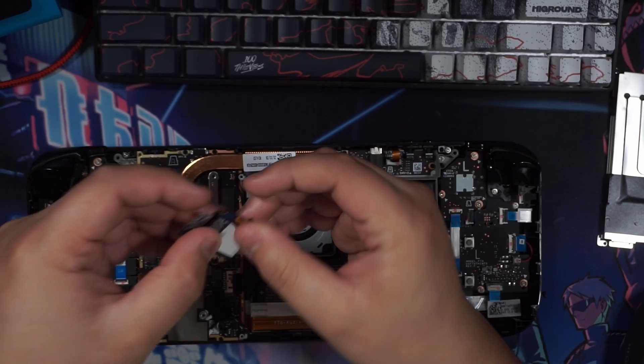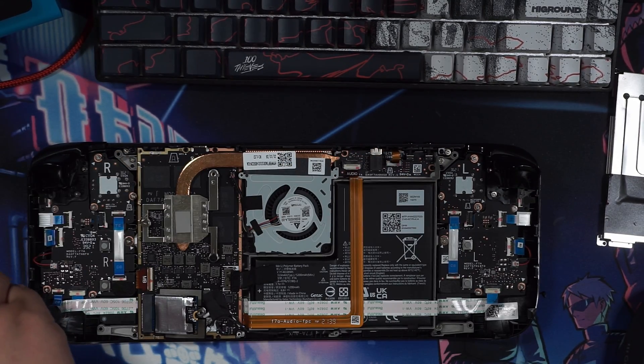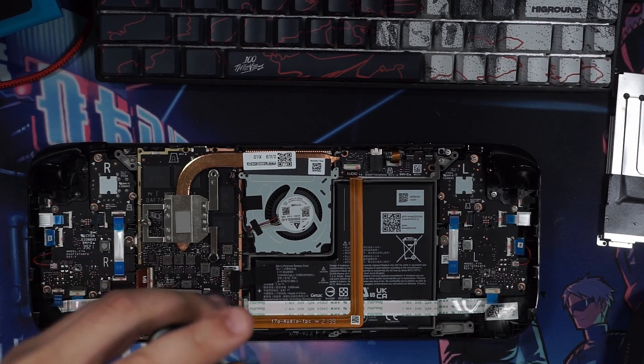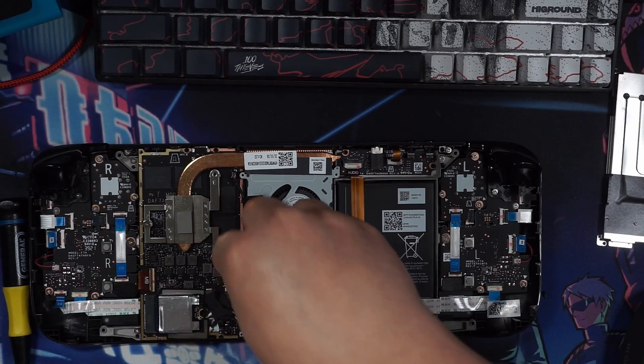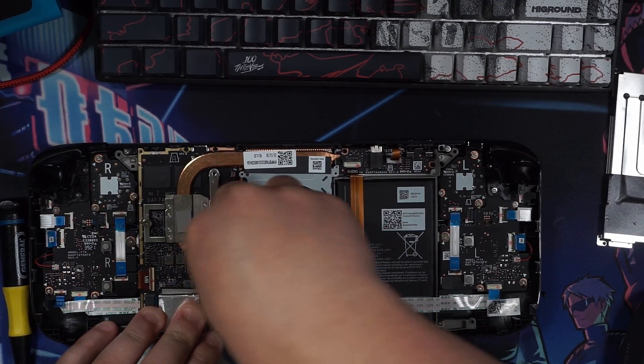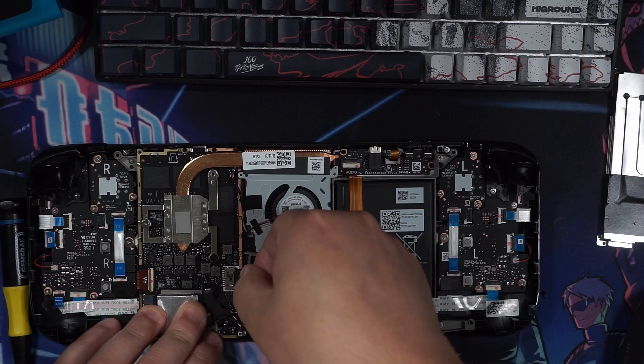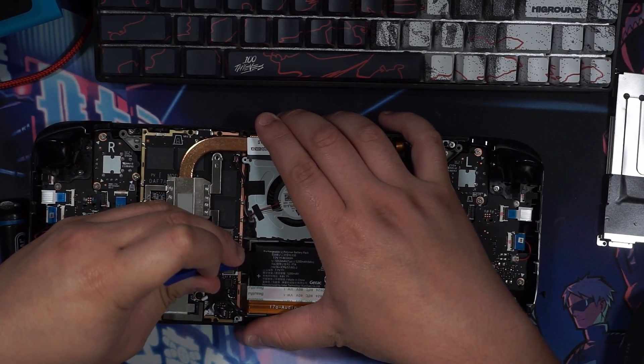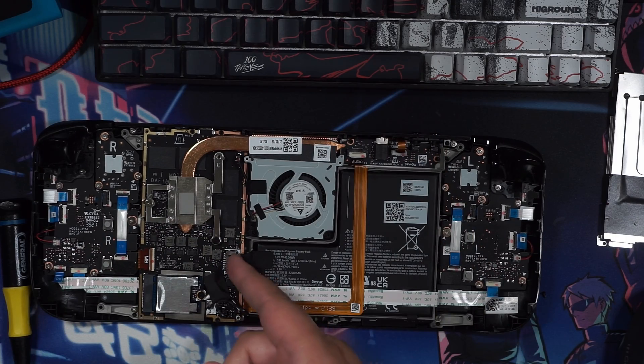You are free to take off the internal storage now by unscrewing the screw and taking the SSD out. Note that it has a metal shielding as well. Take that shield off, place it onto your new M.2 NVMe, then screw it back into the slot. From here on out, reverse the process to rebuild the deck, taking very special care with the battery connector and making sure it's fully in. I have seen many Reddit posts of people who think the Steam Deck won't turn on because of the upgraded storage, when in reality it was because of this battery connector.